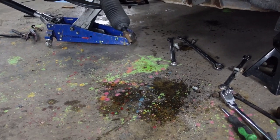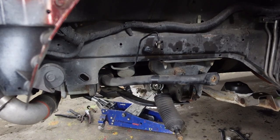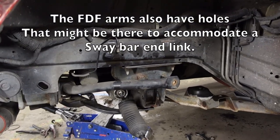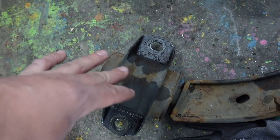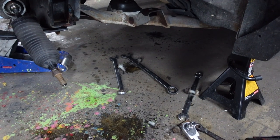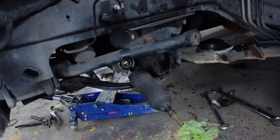The driver's side is off now. I need to do some research on whether the sway bar is even needed — Drift Games had some issues with theirs. I might need longer end links than the BC ones, so the factory ones might actually wind up working. These rear bolts are a little bit of a pain — if you take a long 21mm wrench and then put another big wrench on that as a cheater bar, it's enough torque to get them off since you can't really get a breaker bar in there.